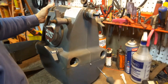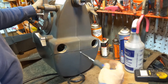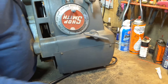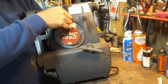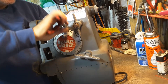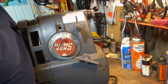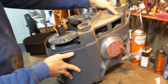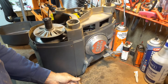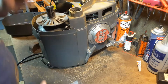I like to remove this front screw first on the motor pan. Then I like to take the switch out so that it's attached to the motor instead of reaching in and disconnecting the leads — I like to just keep the switch on the motor so I can test it all. Now I like to flip it like this, and then there'll be four more screws holding the motor pan on. A lot of machines are missing screws and/or clips behind it.